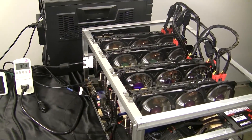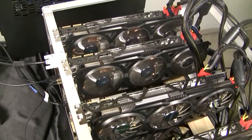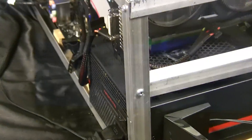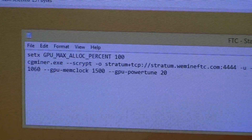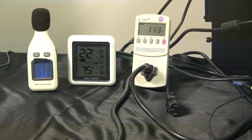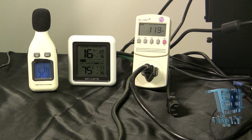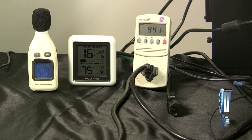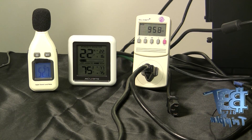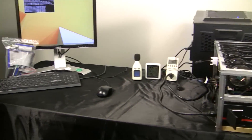For the last card in this shootout, the R9 280X from Gigabyte, we brought back a box from a previous episode. The only change we made was adding a Thermaltake 1200-watt PSU, to see if this one PSU could hold the box up. For this first run, three cards were set at 1060 core and 1500 memory. Starting with just the system up we're holding around 120 watts. Enabling CGMiner the power climbs from 600 to 940, stabilizing around 950-960 watts — about 297 to 300 watts per card.